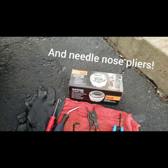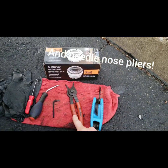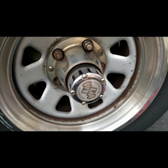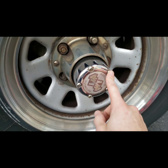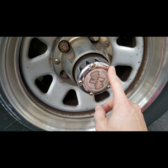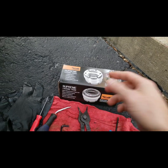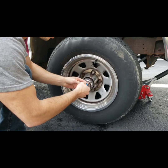All you're going to need is two picks, the Allen key that comes in the kit, snap ring pliers, and a T25 hex head to get these bolts off. Just keep in mind that this kit only works by itself for the five-bolt caps. If you have a three-bolt cap, you'll need a conversion kit in addition to the manual locking hubs.